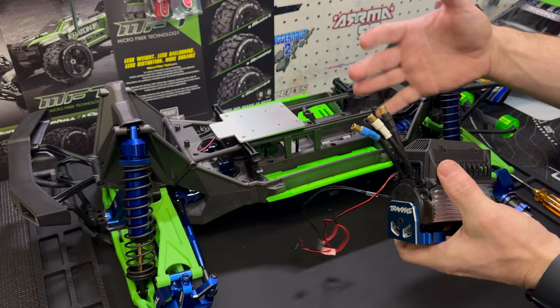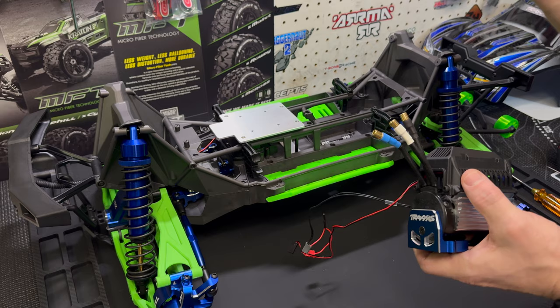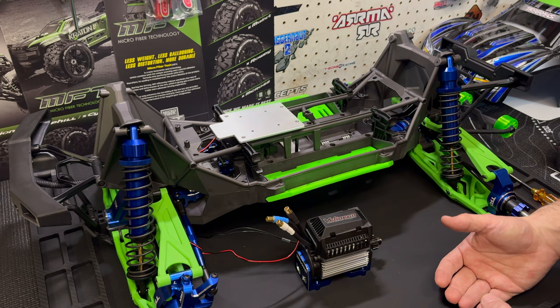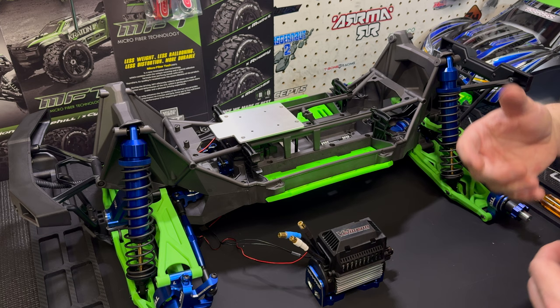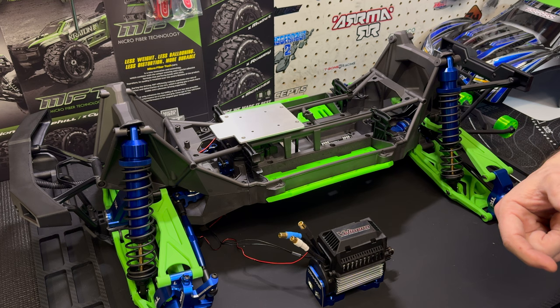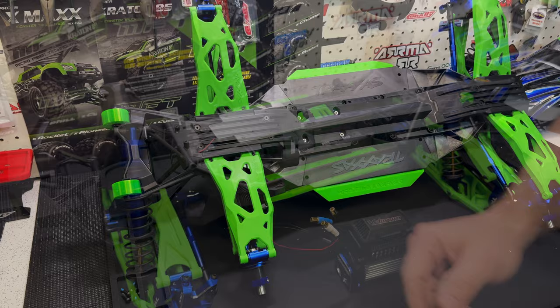If you're thinking, well then why are you changing out your ESC and motor to something bigger? Because I have plans for this truck — I want the big power for what I want to do with it. It's not going to be some high-flying basher; it's just going to be a lot of fun to drive and rip around. I know some people wonder why you upgrade ESC and motors when a Max 6 with a few gearing tweaks gives you a really good X-Maxx. But either way — axe those pins, get an aluminum motor mount, motor mount washers, and trust me, that issue will go away.